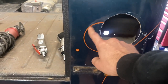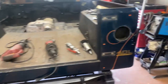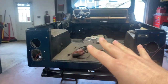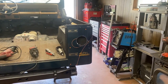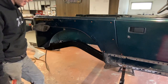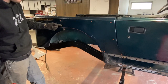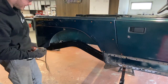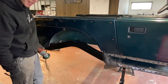For the holes we'll need drill bits, and I'm gonna hope my hole saw will work, but I don't know if I'll be able to get a center. I'm going to do the entire passenger side and then move on to the driver's side, just in case I mess up something over here I can correct it when I get over there. This line doesn't need to be an absolutely perfect cut because the armor will cover this edge — you want to cut on the inside of this line so you don't have any of the body protruding below the edge of the armor. There are some internal supports in here that once we get to that we may have to address.